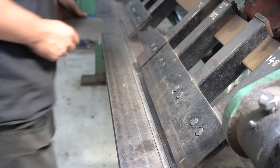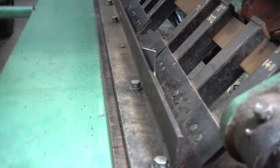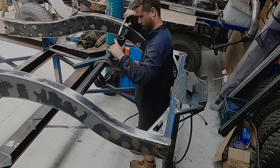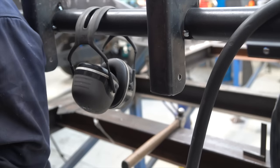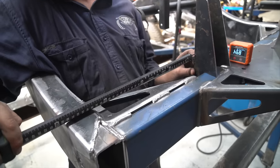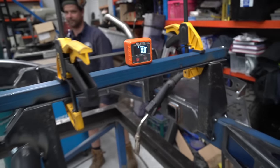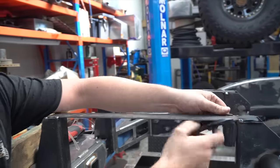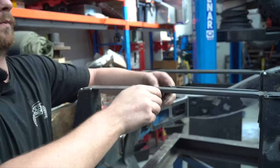After that's all done, Connor can begin folding it. Now comes the somewhat tedious part of setting the front and rear cradle up for welding. Everything needs to be square and millimetre perfect so the tank can be mounted correctly. We're doing the straps for the fuel tanks and then we'll get the lower ones on and hopefully test fit the tank. Tank strap rubber is being used between the cradle and the tank. Here you can see Connor installing it so we can mock up the bottom straps properly.